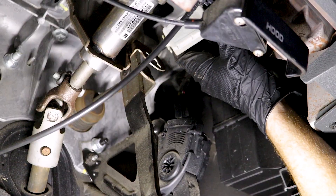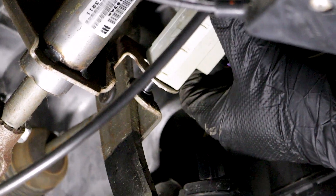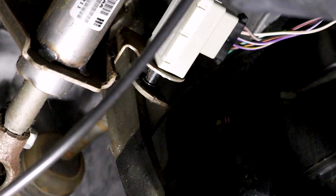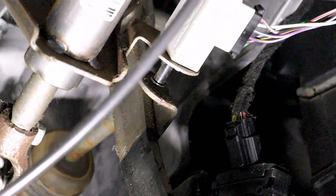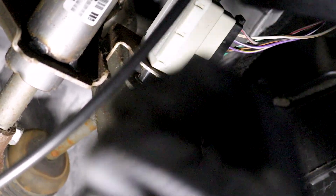This brake light switch doesn't have an adjustment, but assuming it did and you had it in the vehicle, what you would want to make sure is that you have a tiny bit of pressure on that piston so that it didn't just turn on those brake lights every time you barely touched the brake pedal. Obviously, hitting bumps down the road — the person behind you is not going to want to see those brake lights flashing like a maniac.